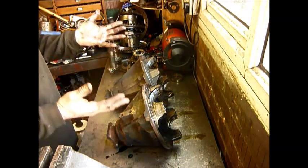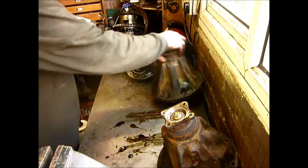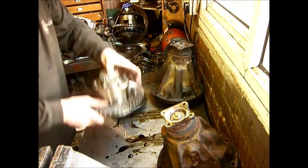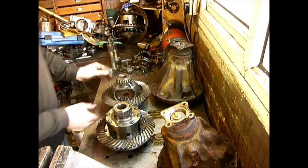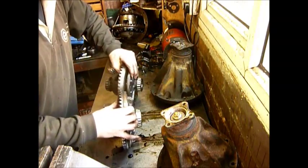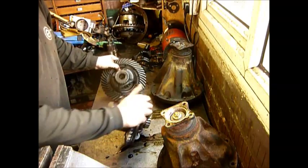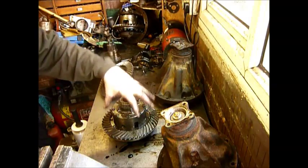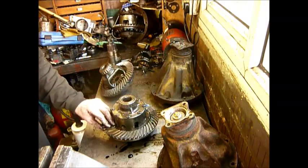The net result is these are two entirely different diffs. You can't just swap the center over between short nose and long nose. Here's the long nose one I took out earlier with the ring gear taken off, and here is the equivalent short nose. The heights are different, the positioning within the casing is not the same, the crown wheel is a different thickness, and you cannot just bolt this unit in. We do actually machine these and make them fit the long nose casing, so you get the advantage of the strength of the short nose center put into a long nose casing which you can also peg.